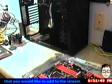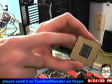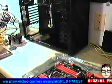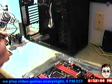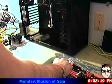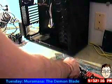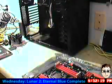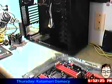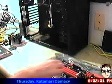Get the manual up here. I found it. Here, look. Oh, you found it. Okay, then that's definitely the way to do it. It's not dangerous unless you plug the power supply in and then lick it. Well, the only thing dangerous right now is if you're not grounded while you're touching the processor, but it's fine. All you really need to do is touch the computer chassis and then you can work with anything at that point. CPU should be mounted, it looks kind of wobbly.